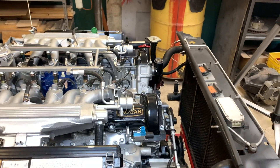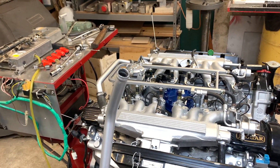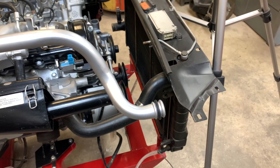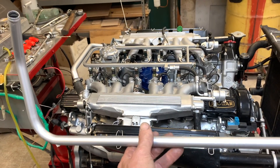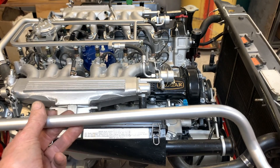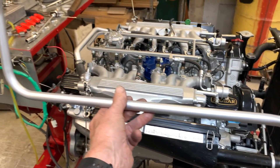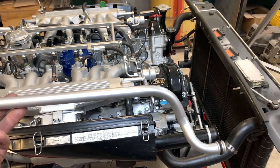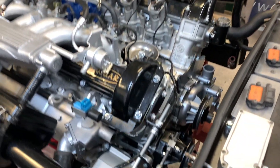You could just leave it hooked up to the air pump, but then if the pump is working you'd have air — and potentially dirt and rust — blowing on the back of your engine, which isn't ideal. You could jack your car up, take a small reciprocating saw, and cut this in a couple of places to pull it loose from under the engine. Or you could just disconnect it from the pump and leave it there. If you ever have the engine out, then you could eliminate it — but at that point you've got bigger problems than a steel tube running under your cylinder head.